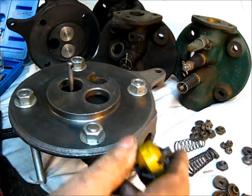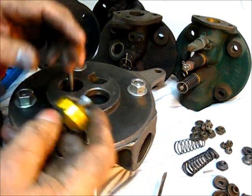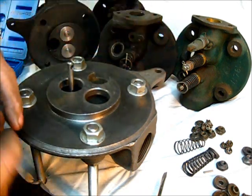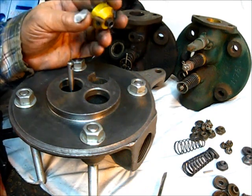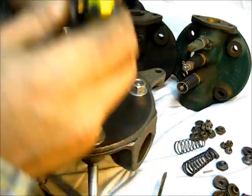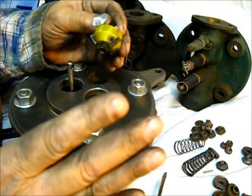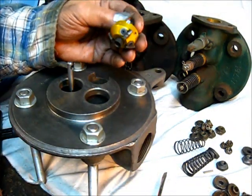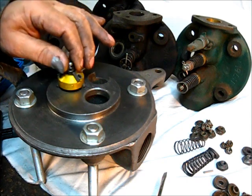The cutter head I'm using today is the Neway system — spelled N-E-W-A-Y. This is not meant as a how-to article; it's just the way I do it. This particular Neway cutter head actually cuts a 31 degree with these cutters here and a 46 degree with these. The valve face on the valve will be a 45 degree; the seat will be a 46. So you put this on the pilot with the 46 down.